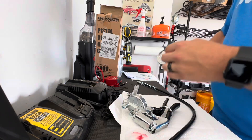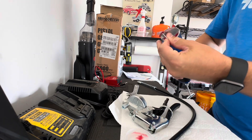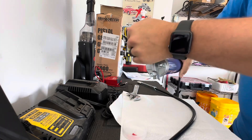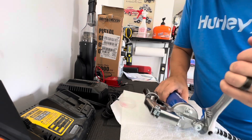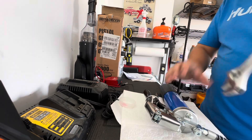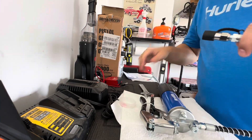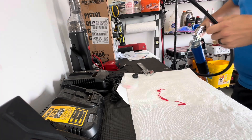Pull the plunger back to where it's flush, then take the cap off. This is really good grease. Put the end cap back on, then screw the nozzle end in here — you have to screw it on tight. Get some of the air out of it. All right, let's go put it on some grease fittings.